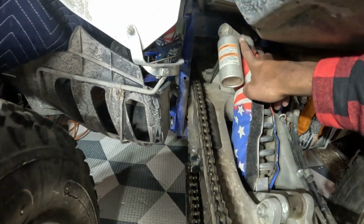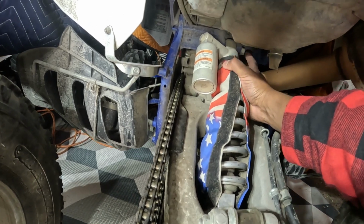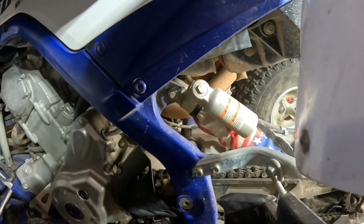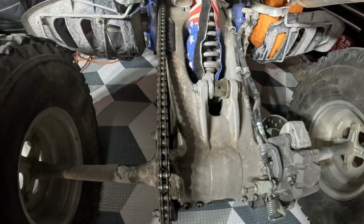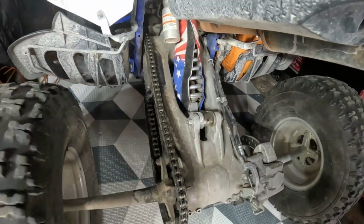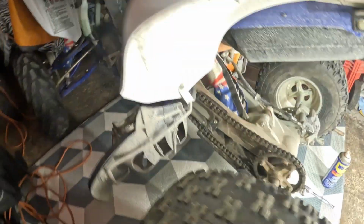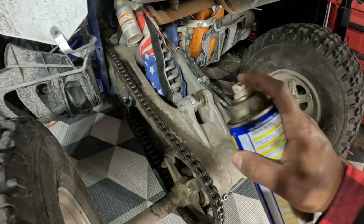And on top there is one bolt going across from the top there. So right here there is one bolt, the nut right here. So we'll go ahead and get that loosened out. What I'm gonna do is basically just clean up the threads a little bit. Mine is pretty good, as you can see, but in most cases, if you're riding this bike, most likely you have some kind of dirt or sand. So I'll just clean up the thread a little bit, and after that we'll just put a little bit of lubricant, WD-40. That works fine.